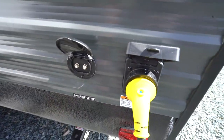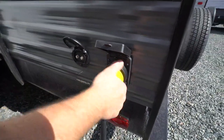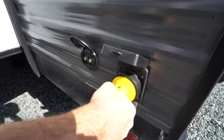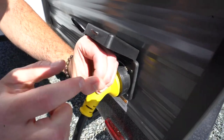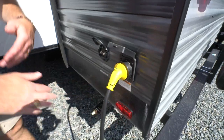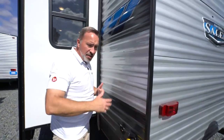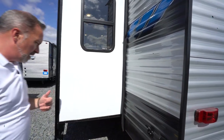Your cable connection as well as satellite connection and cover right here. Plus you'll have your 30 amp plug right here. One thing we always like to say about the plugs — make sure when you turn it, you lock it. A lot of times if you're lucky, your cord will also have a light to let you know that there is power. If you're locked in and you're not getting power, check the breakers at the junction box where you plugged into the campsite to make sure you're getting power.